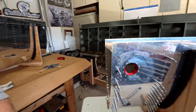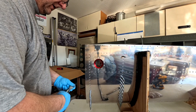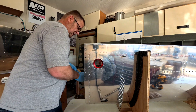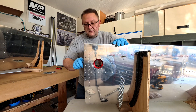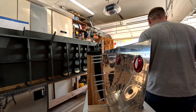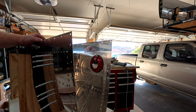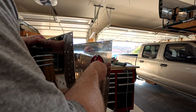Helpful tip: don't put this side piece in there — it's in the way. You'll need to remove it and clean it up after you get sealant all over it. Leave the outboard rib out last; don't put it in even with clecos in it — it's in the way. With it left out, you have complete and total access to make sure you have a nice fillet around the edges, and it's easy to get to the flange and the rivets.